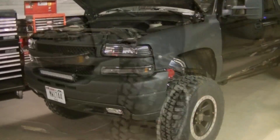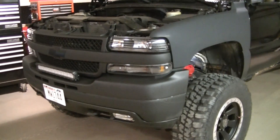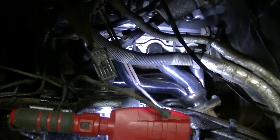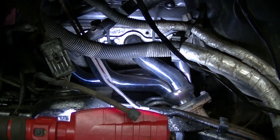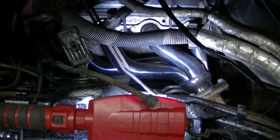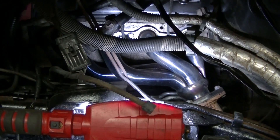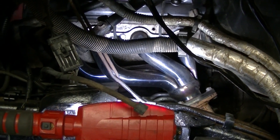We're going to get that last spark plug in there. I've already got it gapped, so we'll get that in. Okay, so the last spark plug is in, and I switched over and tightened all my header bolts. Some of them had loosened up — I could feel where they loosened up. Headers are known for that; they'll loosen up over time, so you've got to check them. Everything's looking good.